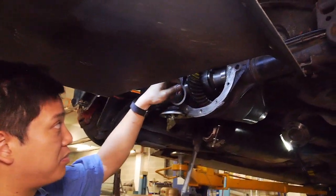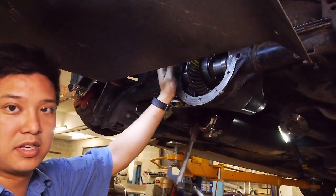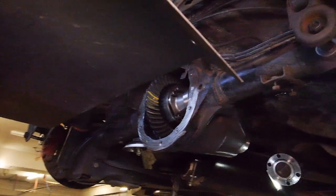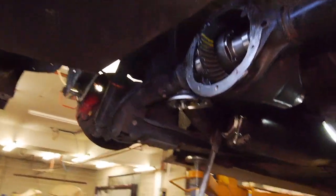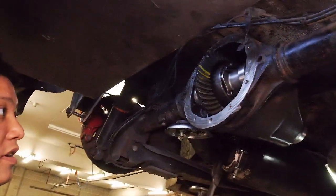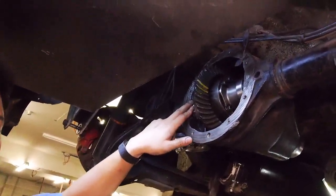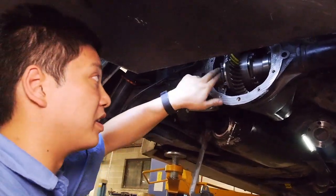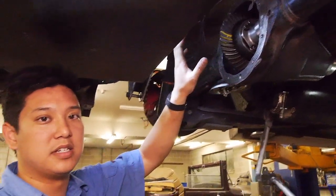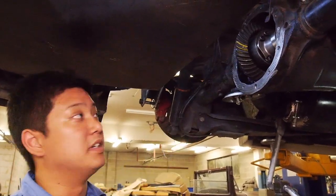It really depends how the contact patches appear on the gear. You can see we've got some paint on there. We did a rough look before which confirmed our thoughts. So at the moment, that's the easiest way to achieve what we want so we can at least get the whole gear set to bolt up properly and get a decent pattern happening on there.